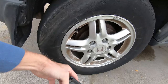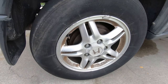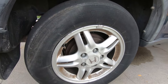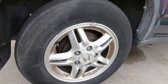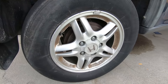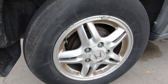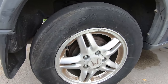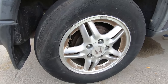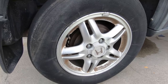I've got this digital torque meter — I'll put the link in the description since people are always interested in the tools I use. We're going to measure the torque: I'll torque the lug nuts down to their recommended torque and see how much it takes to pull them off. They should all be pretty even, and when we get it back from the shop we'll see if they're all similar. They could be using torque sticks on an impact, so we'll be measuring the effectiveness of that too.